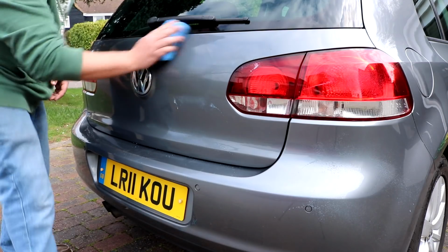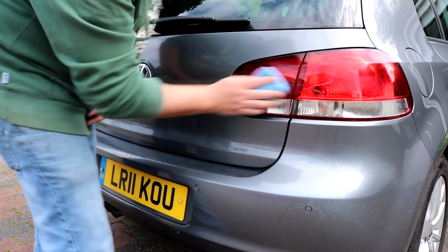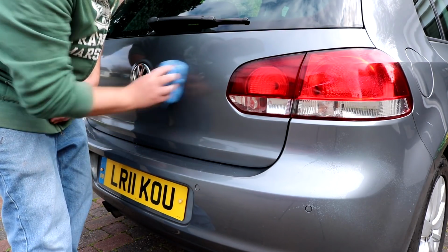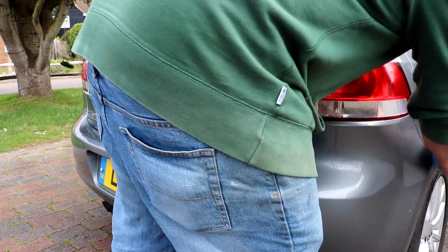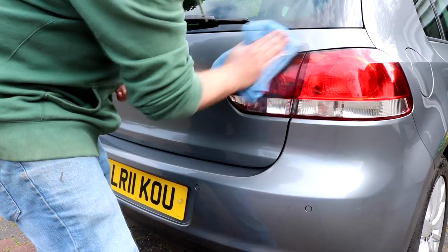The most effective way, in my opinion, to do the initial application is to quickly towel dry 95% of the water off your car, but leave the odd little bit of water on there that you can utilize during the application. Then get a microfiber cloth or applicator, soak it in water and wring it out. Then spray this onto your panel. You don't have to use too much. Work this emulsion or resin over the surface of that panel, one panel at a time. Once you've got the coverage, take a dry microfiber and buff it.